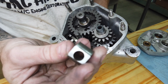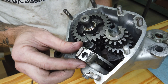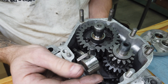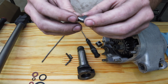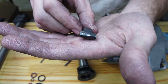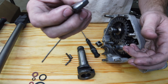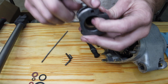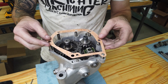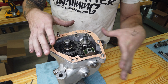You have to install this knuckle here now — you cannot put that in later. If you put your cover on without it in place you're going to take that cover right back off. These kickstart pawls can be pretty worn out — you can see the difference where it engages versus the original. You don't want to put a worn-out one back in because it's just going to slip when you try to kick it. I'm going to go get a new one and reassemble it — the springs are nice and tight, everything else looks good.